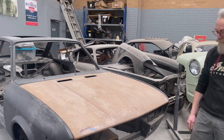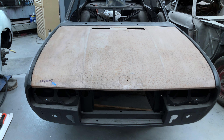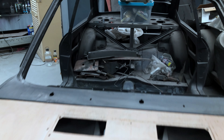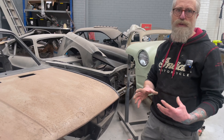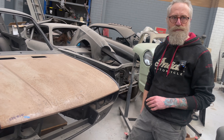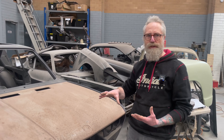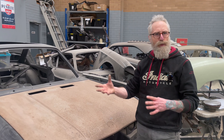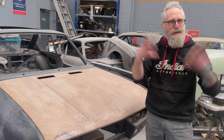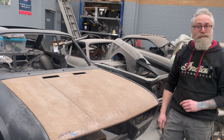And will this be re-modified or go back to factory? All factory. So this was all crunched back — I had to bring all that back. It was getting pretty thin because of previous repairs. Usually when repairers grind the living daylights out of something there's not much left of the steel — it's pretty thin. You go to beat it and you start getting creases in funny places, and it's just too thin, so you have to cut out pieces and replace where it's been over-ground.